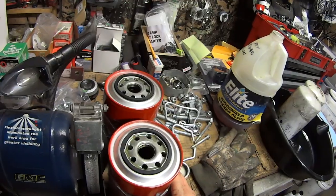The guy I drive dump truck for — I changed oil on a Mack. I pre-filled the oil filters and as soon as I started it up, it didn't take any time for the oil pressure to go right up. Then just one time I decided not to pre-fill them. A Mack has three oil filters, bigger than these, and boy it took some time for that oil pressure to go up — scared the hell out of me. The odds that it did any damage are pretty slim since all your parts still have oil slung on them, but it's just nice to see oil pressure go up right away. That's generally what helps — filling your oil filters prior.